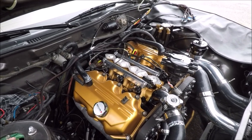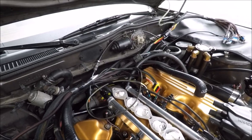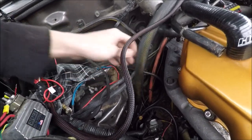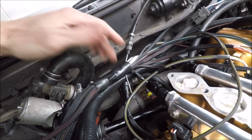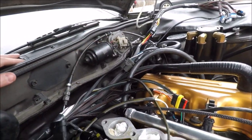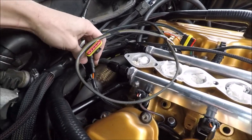The harness lined up with everything a lot better than I thought — right now it's just sitting on top and this isn't the final position, as we'll probably take it out again to do the fuel system. The connectors fit through the firewall through the stock opening with no problem. The branch off for the relay box has lots of slack, so you can mount it anywhere near the battery. At the junction where everything breaks off, I like that Felix designed this kit with connectors so you can disconnect the injector harnesses separately from the main harness. All the injector plugs are plugged in and tuck neatly underneath the valve cover, with a single connector for the harness side.